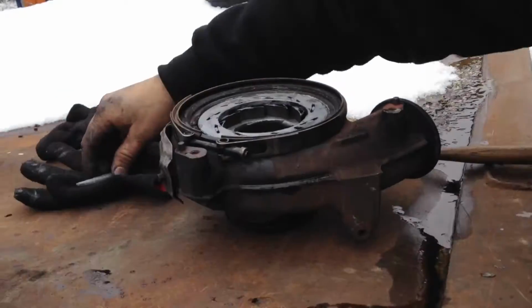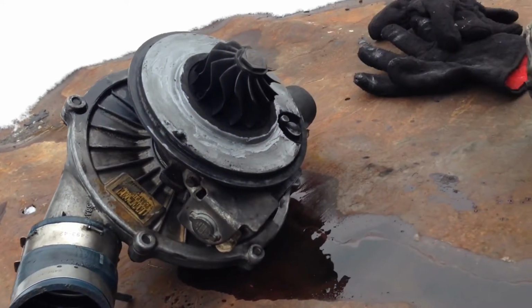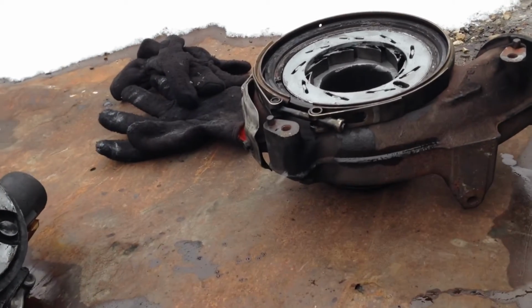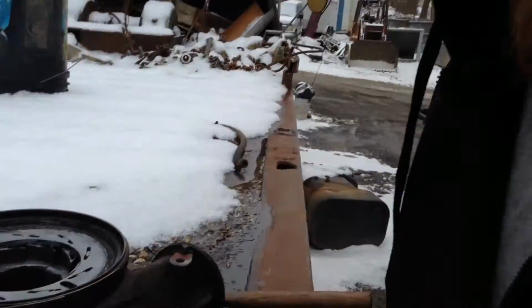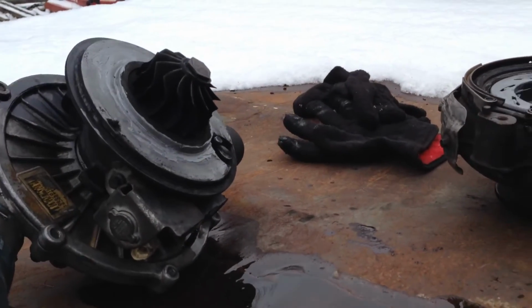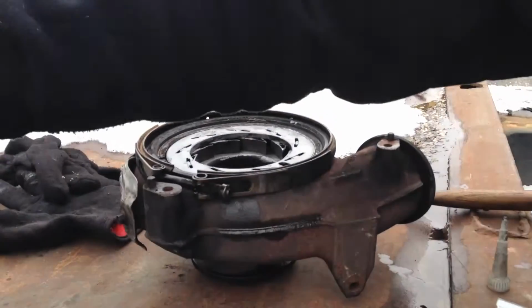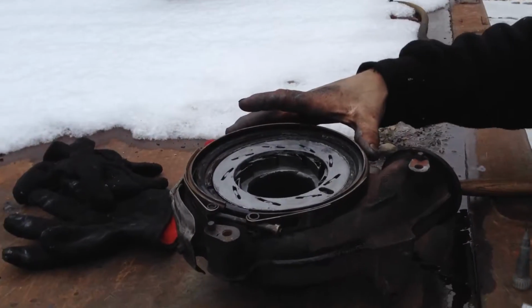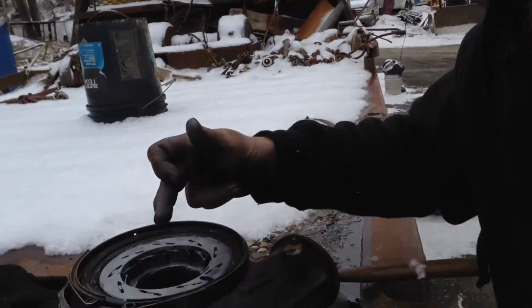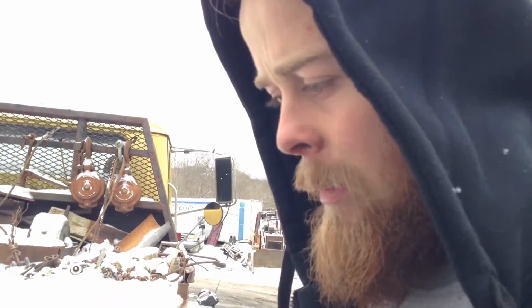Make sure that this area here is nice and clean of any kind of debris. You can use a wire wheel, wire brush, grinding disc, or a small scraper. Nothing that's actually going to mar it or take a chunk of the metal out. The idea is this here to here is actually your seals. If it's gapped or screwed up, it won't really go back together, and if you force it back together, you're still going to have an exhaust leak there. You'll lose back pressure, and loss of pressure is loss of boost. It's no good.